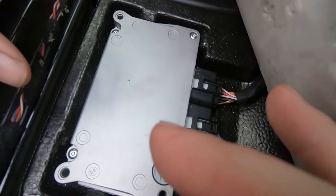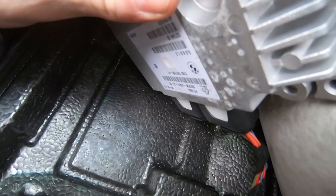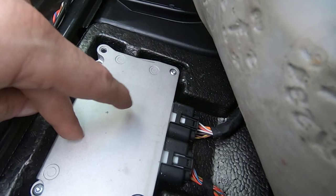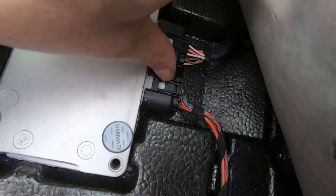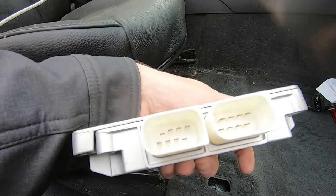You can see there's some stuff right here — right up here on the front you can see a little bit of moisture. So what I'm going to do is pull these connections off and see if there's any corrosion on them. Hopefully I can clean them up and hopefully I don't have to disassemble the whole unit. For now I'm just going to look at the connectors — it doesn't appear there's any corrosion on the pins, as far as I can tell it looks good.